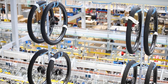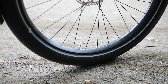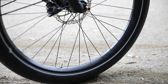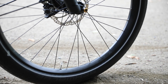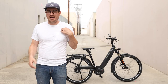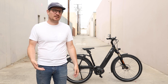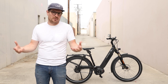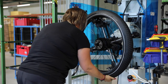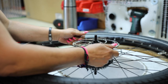Having a wider tire is going to be less likely to put stress on the frame, because bumps in the road — this tire can soak some of that up. As opposed to a really rigid frame with a really stiff tire: as you hit those bumps, it's all going to go into the frame, and if there are any weak welds or anything like that, the frame is going to flex and potentially crack. I don't want to scare you, but it's important to consider because you want to be safe and make sure the bike isn't going to break underneath you. That's part of the reason why it's important to select a quality manufacturer — one that's going to stand behind their product, because bikes can break and you want to make sure you're covered.